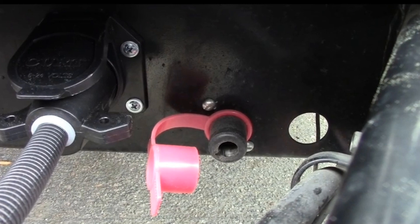Here is another installation I did for my son on his trailer. We mounted it underneath the front of the trailer on the front cross member. The existing hole on the right was too big to install the switch properly, so we left that alone. The plug on the left connects to the batteries on the trailer from the tongue jack — the electronic 12-volt tongue jack has this coupling so you can plug it into your vehicle and use power from your vehicle.